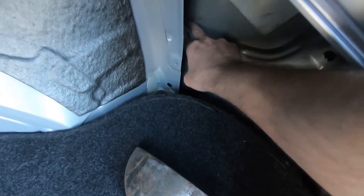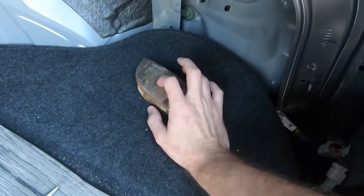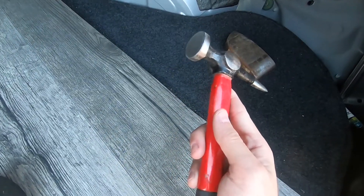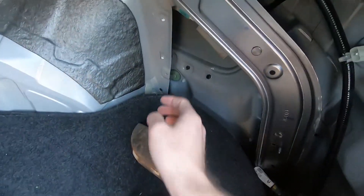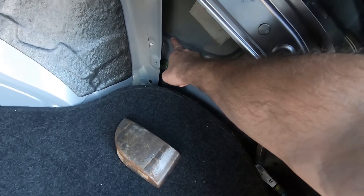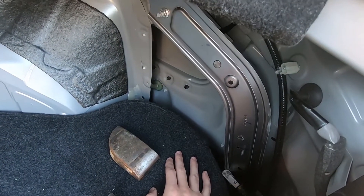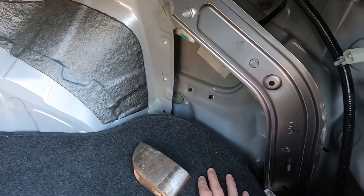Now that I can see back in here, I'm going to survey the issue area. I'm going to bring the dolly in right here where the small crease is in the panel, hold and apply pressure to that with the dolly from the back side, and from the front side slightly tap around the dent with the polished hammer. Hopefully that will relieve some of the pressure and stress in that little area. Once that's out I'll reassess the dent and then use the dent repair kit with the crossbar to try to pull out the rest.